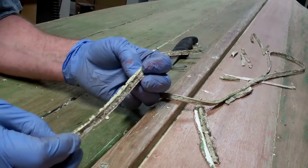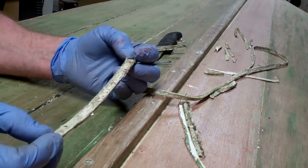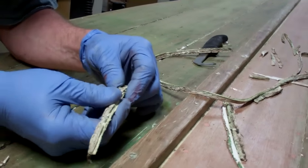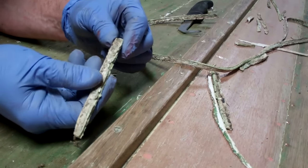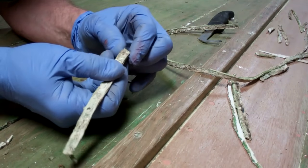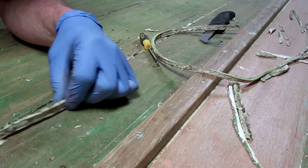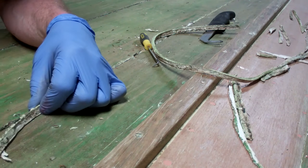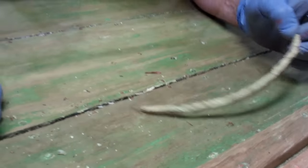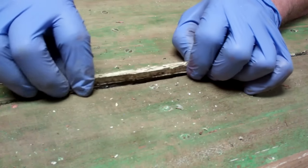John just noticed something worth pointing out. Not only did this 5200 destroy the planking of the boat — it didn't even work. It never adhered to the board. As you can see on the sides of this 5200, there is nothing but dust and debris. Probably because each one of these boards has a slat in it, and if it wasn't properly scraped down to bare wood in the seam when you put the 5200 in, it adheres to the old debris on the edge of the board. That's why we can easily pull it right out — it actually never adhered.